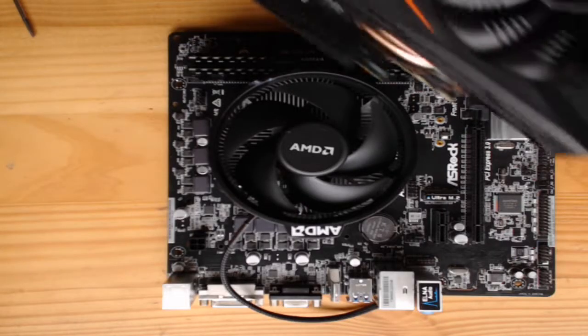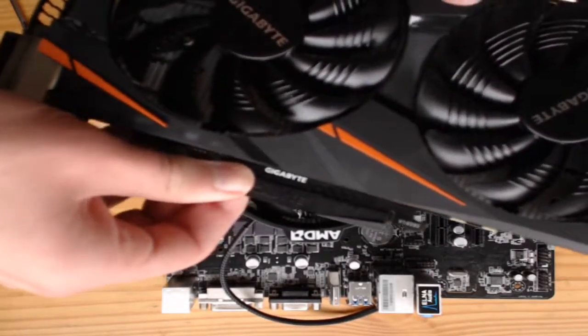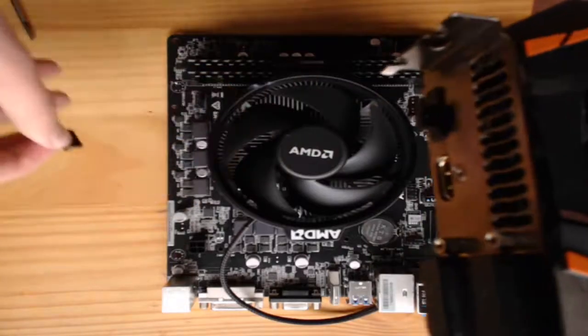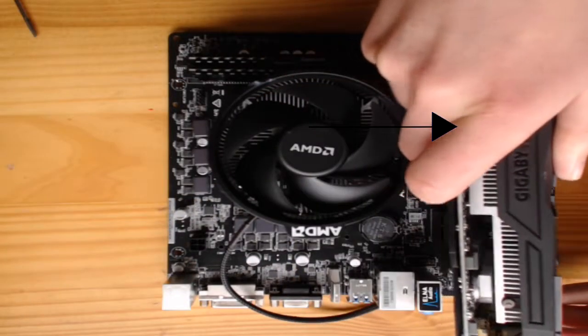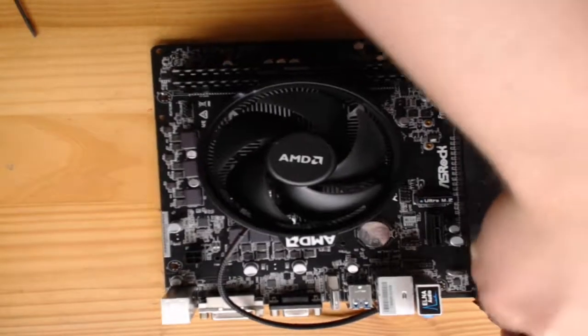The final piece we are putting in is the graphics card. Now, with the graphics card, make sure you have the port protectors taken out, as this may cause you problems when fitting it into the PC case. I found that putting in the graphics card is the same way you put in the RAM. Make sure you undo the lock of the port when you put the graphics card in, though the graphics card required a bit more wiggling room.